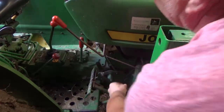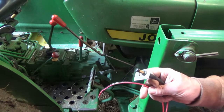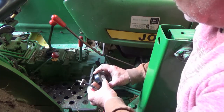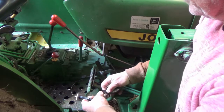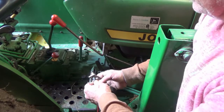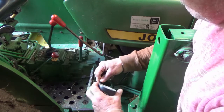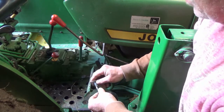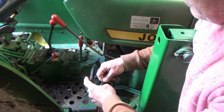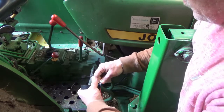Alright, so I've got my hole drilled in the pad. I made my wire connections on my switch and checked them with my meter to make sure it was going to function as expected. If I had quarter-inch loom — that plastic flexible stuff — I would wrap it in loom, but I don't. So in its place, I'm going to use some electrical tape and start off at an angle. You want to make sure that you're watertight or as close to watertight as you can get. I did use some heat shrink wrap.